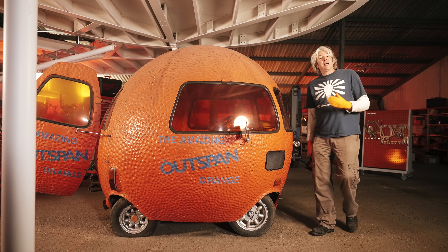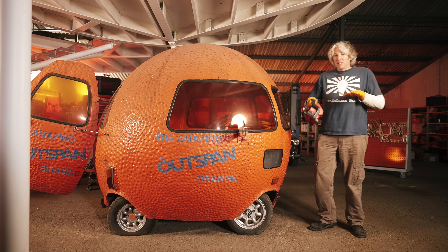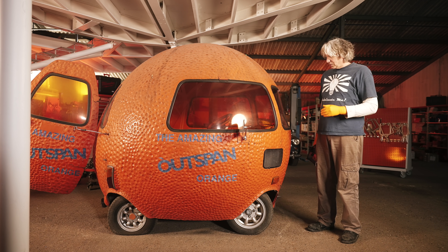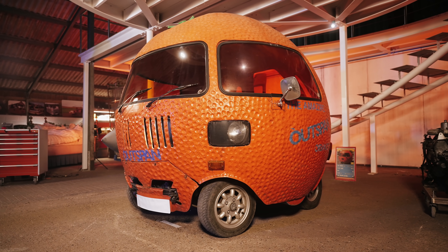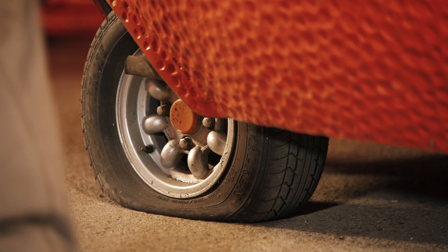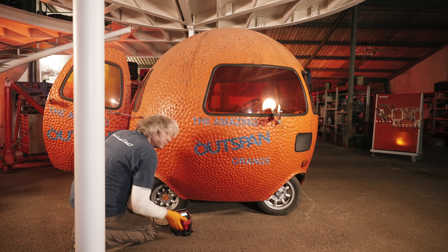The classic Mini was obviously renowned for its wonderful handling, and that was mostly down to its tiny size — it had a wheelbase of about 2 metres or 80 inches. But this is Mini-based, and they've actually taken the rear and front subframes and squished them together even tighter, giving a wheelbase of 1.2 metres or about 48 inches. Interestingly, the track of the Mini is also 48 inches, so the wheels sit in a kind of a square, which makes sense at the bottom of a sphere, and means the handling is even more lively and fun. We've got a flat tyre over here — a slow puncture — so I set the pressure to about 30 PSI.